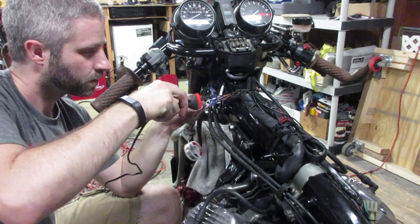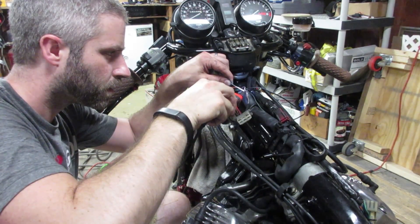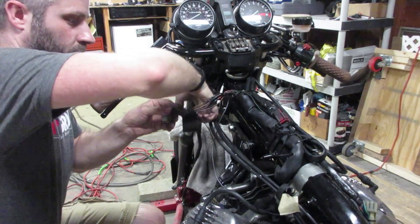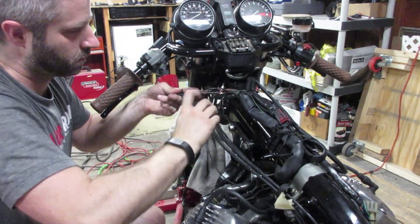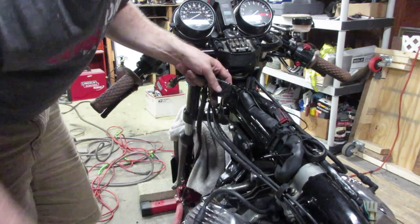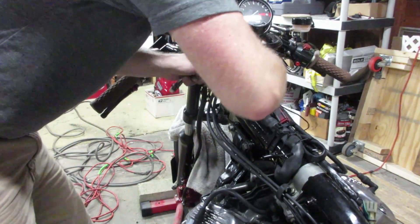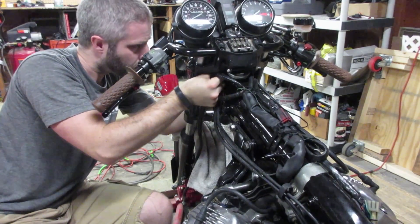What I'm doing here is actually adding in a new wire to the original connector that allows the relay to be turned on when the remainder of the bike is turned on. I'm pretty sure that the '79s didn't have an accessory harness anyway, or at least the customs don't. So for those of you with customs, this is what you're going to be doing to enable power to turn the relay on.